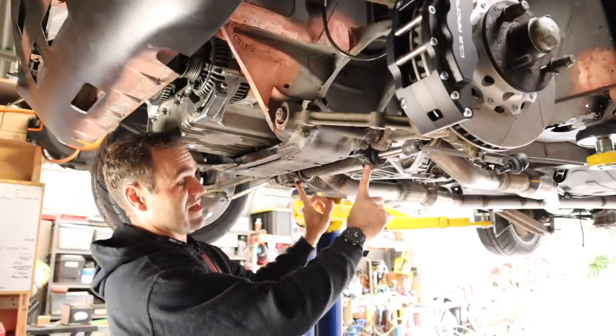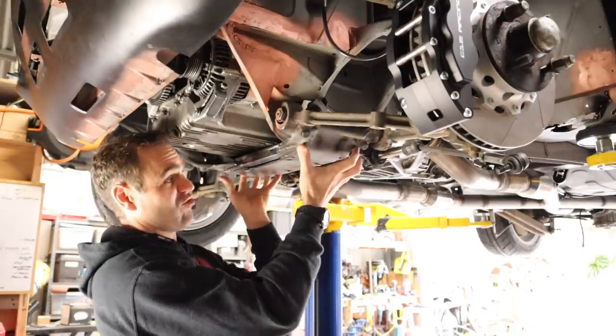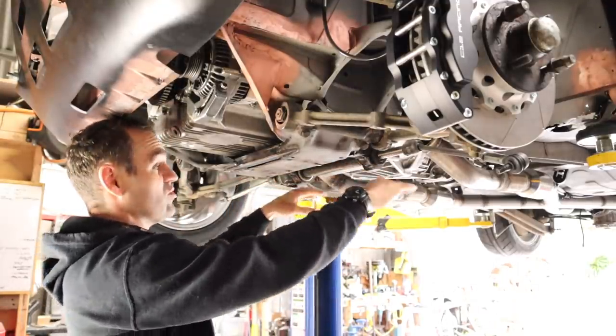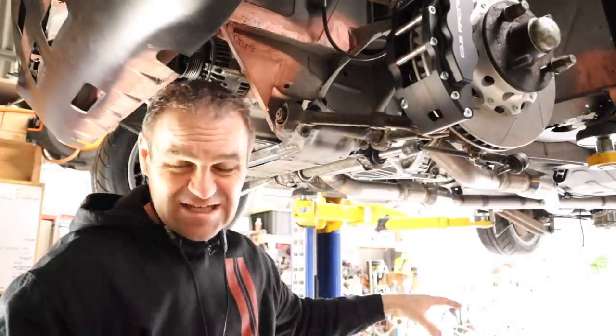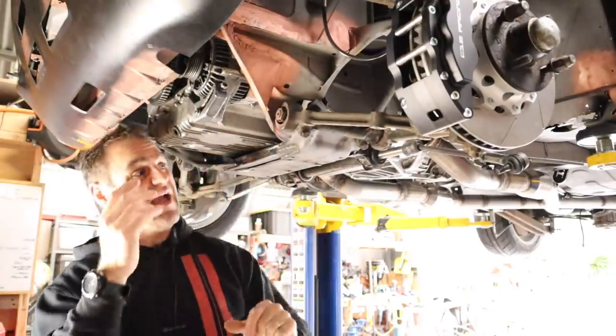And also the steering rack is sitting lower than this front cross member. It's just the way I had to mount it in this car, and I want to protect that slightly. Now, the exhaust does sit a little bit lower again than that further on, so I'm less concerned about that, but we do need to build some sort of a bash plate here.